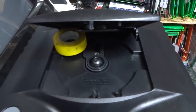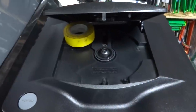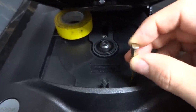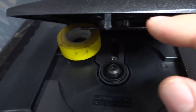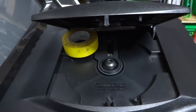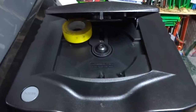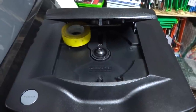These are the main things I've found over years of repairing these systems. The most common problem is the door pin breaking off, followed by the micro switch post not making proper contact — sometimes the spring is gone, sometimes the post is only half broken and not depressing fully. Check everything mentioned in the video and see if your Neo Geo CD has any of these issues. Hopefully this helps someone out — I'll put up another video soon. Thanks for watching.